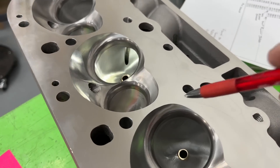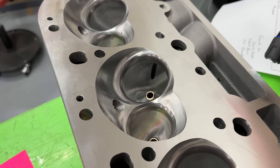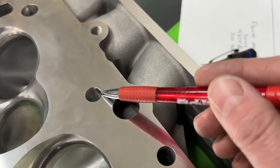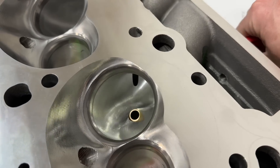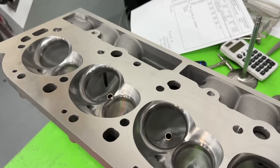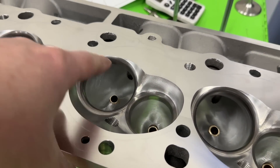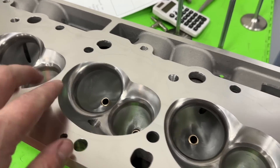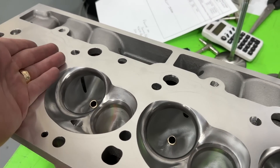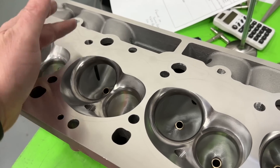This is the long port, and some people are going to spot this. See that hole there - that's the head bolt hole. The head bolt goes through that hole, and this is normal on every big block Chevy head I port. I only port aluminum heads. I will break through, and on the long ports you don't have that problem on the short port because the bolt's so far over, but on the long ones you will every time.